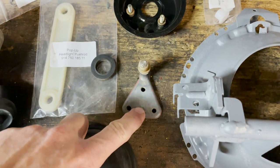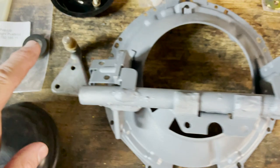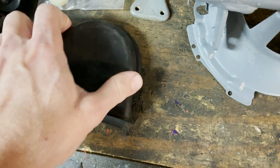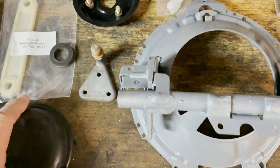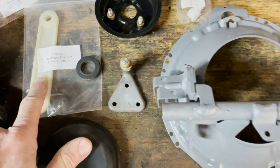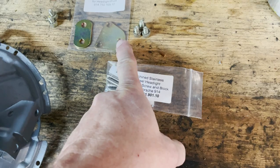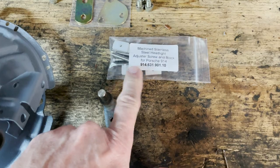This is one of the pivots — the inside pivot actually — and the outside pivot is over here. We're also going to change the bushings that go on the pivots themselves. This is the actual headlight bucket. Here's the rubber cover that protects the part of the motor that sticks through the tray, and we have the bronze pivot which goes onto the headlight bucket and into the actuating push rod. Over here we have the plates that hold the headlight bucket to the car, and the new stainless steel headlight adjuster screws.